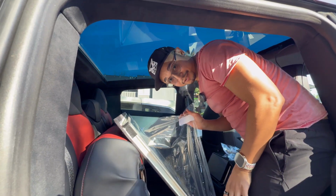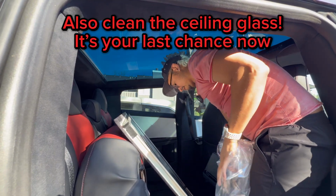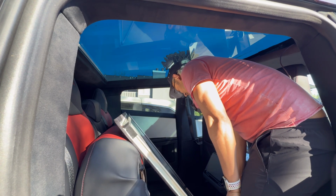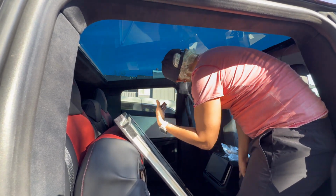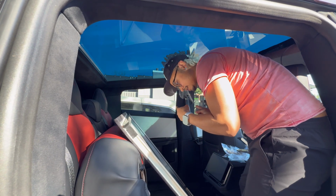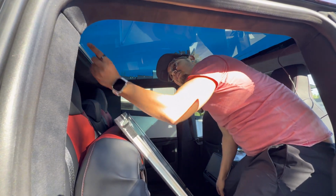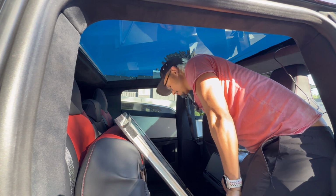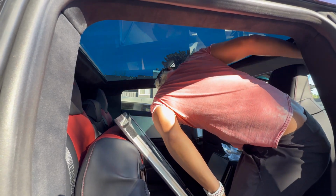All right, before you install this thing, don't forget to peel off the protective plastic, because once we raise this into place, it's not coming back down again to take that off. So how this works, we're going to move the front into place, and that's going to slot in with those tabs we installed in one of the first steps. The back side is going to swing up, and then we're going to secure it with those 4 little button screws that I took off earlier. But before we do that, we got to plug this thing in with these cables